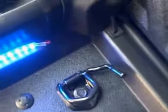of the bed. On the inside, I came in and just drilled a hole to where this ends, and this plastic strip will lift up, and you can actually pull these wires down. And you can cut the excess wire off before you join the next strip. What I used on here, sorry, it's a little shaky, was 16 gauge butt connectors, and then ran another hole, came right back into the next one, and then ran the wiring up and around, and then back down to the back of the bed. It's all hidden in here.